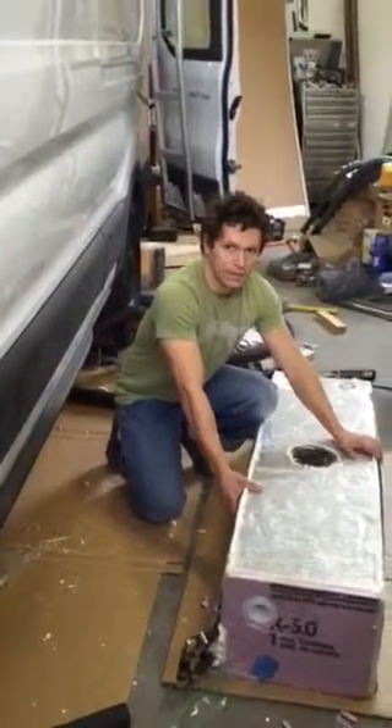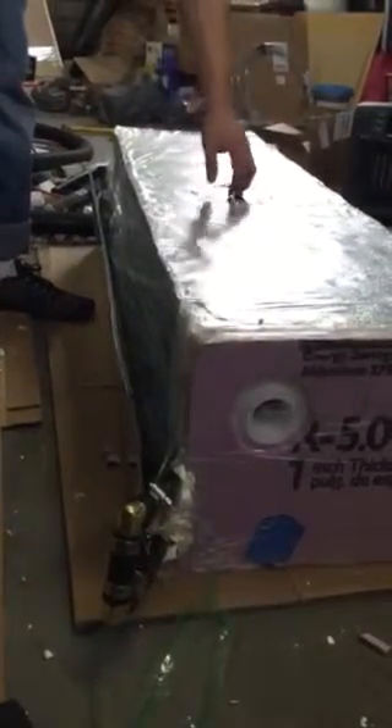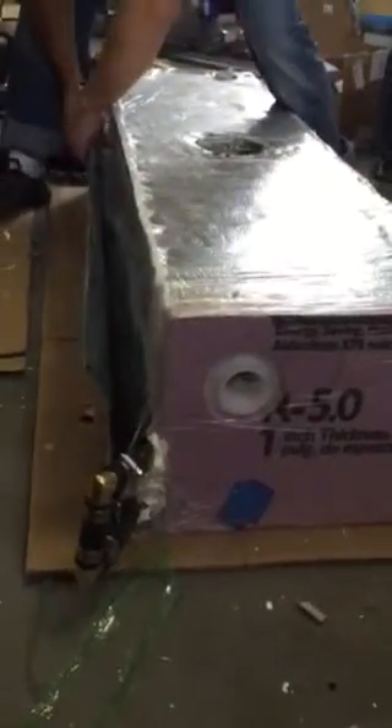So where'd you get the tank again? UStanks — I think it's UStanks.com, just Google it. They're pretty easy to work with — they send you a template and you work back and forth and have a discussion around the inlets. This inlet was actually done here at home; you have to connect it from the inside. I have access at the top but I wrapped it in plastic because I won't need to get in there unless I have to clean it. So this is a recap of how we're installing the glycol hoses to keep our gray water tank warm at freezing temperatures so we don't have to use our solar energy to run electric heat pads.